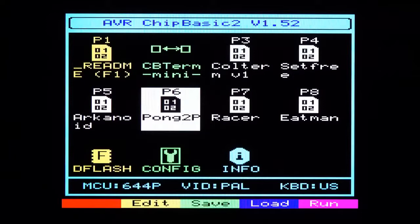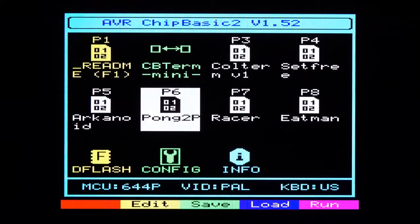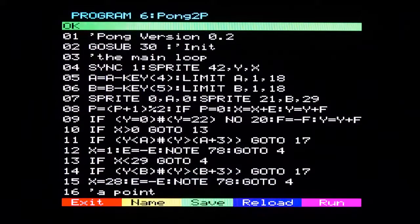Let's take a look at the meaning of the different icon colors. Many icons are white — a white icon stands for a BASIC program. On the top left we have a yellow icon, which is a text file; text files always have names with a leading underscore. On P2 we have a green icon, which is a binary executable file. But most files on the CB2 micro will be BASIC programs with white icons. If you want to view the BASIC code, select the program and look at the bottom line — 'edit' in yellow stands for the F1 key and 'run' in magenta stands for the F4 key.